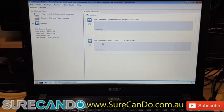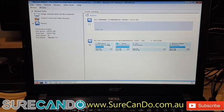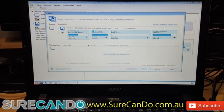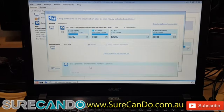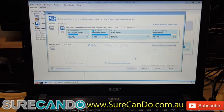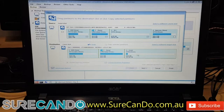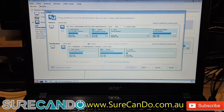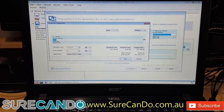Well, what do you know? It could not detect any file system. So I'm not going to bother with cloning it now. I'm just going to do a straight Windows 10 install. Oh, here we go, it came up. Let's say clone page. Okay. Oops, sorry, here we go. Clone to that hard drive, yes. Now this doesn't make sense. How can the C drive be only using 8.9 gigs? Curious. So that needs about 500 megs.